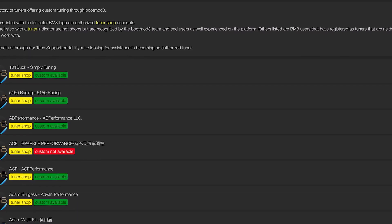The first time I flashed my car with Bootmod it took me less than five minutes to unlock the DME and install the flash, and if I want to bring the car back to stock it takes less than five minutes to remove the flash and re-lock the DME. Flash tunes allow for more customization — I can mess with burbles and a bunch of other settings, and with Bootmod it even gives me the option to flash the transmission. Custom tuners are also very easy to find.